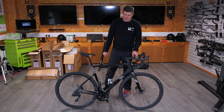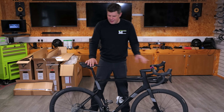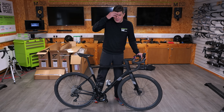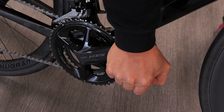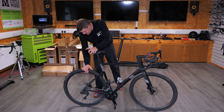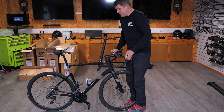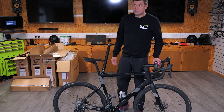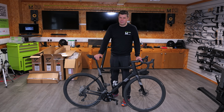24 hours later, hopefully a full cure has set in. Now we're going to run through some tests — if you brought your bike into a bike shop with a creak, we'd normally go around and work out what was making the noise. I did just do this off camera and it made a noise — but it was actually just the rear wheel bearings, so Tom sorted those. Now I can really lean into it in a variety of locations and it feels great. You can eliminate a lot of things by checking the back wheel isn't moving. This one still needs some new headset bearings — there's a little knock there — but I'm really happy with the bottom bracket solution. And if it hadn't worked, you could go to a higher strength or higher fill-gap retaining compound — you can actually go all the way up to 3 millimetres with liquid shim solutions.